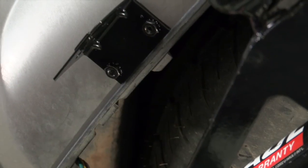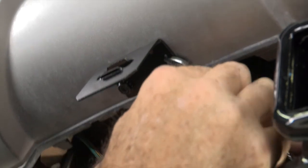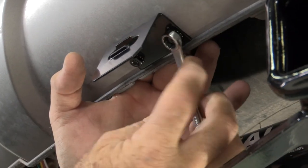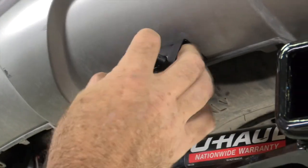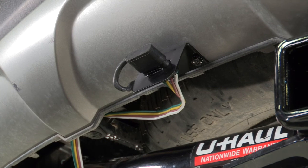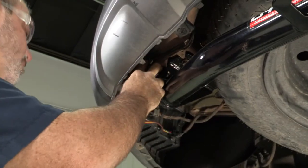Then I'll be taking a 3/8 wrench and just tightening them down — that's good and solid. Basically, we're just going to take the dust cover off, push the four-flat terminal through the four-flat bracket, and it's going to lock into place. Then we put our dust cover back on. Now all that's left is to clean up the wires hanging down here. We're going to take the provided zip ties and zip tie it all up so it looks really professional and clean, with all the wires out of the way and tucked up into the box area.